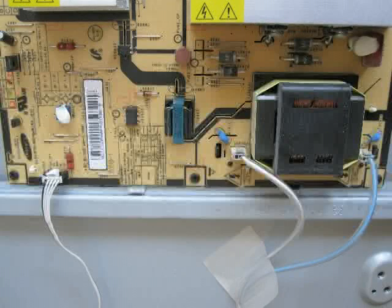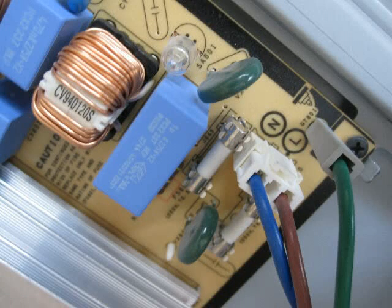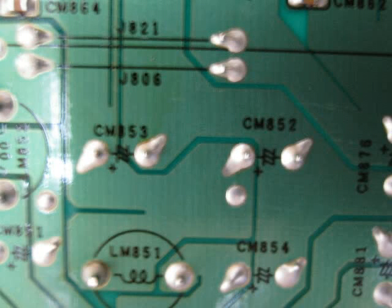I took a picture of the board connection so I'd remember where to put the wires back. Here is a tip for you: take photos of everything along each step of the way so you can remember how everything was connected. Here is the other side so I know where the wires go. A close-up shows the wire connection reads 2200 microfarads at 10 volts and 105 Celsius rating. I read on another blog that the main board uses a 12-volt bus, so the problem may also be that Samsung underrated these capacitors in their design.